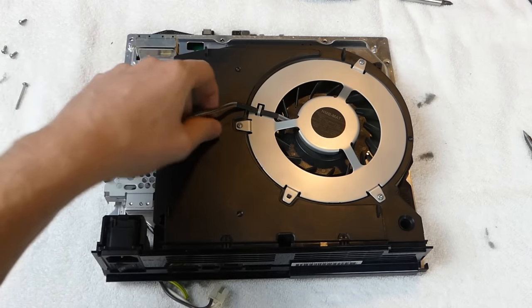Make sure all cables are out of the way and plug everything back into place. Put the front of the console down first, make sure it clips into place - it should go down smoothly and click. Don't forget to put the front panel screw back in. Put the rubber grommet back if you didn't lose it. Then drop the hard drive back in, pick up the little tab and slot it to the left so it clicks in. Take the blue-headed screw, put the screwdriver on it, and tighten it down. Put the cover back on.